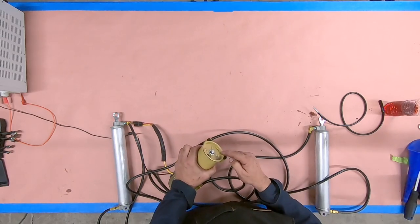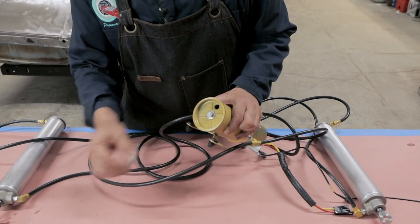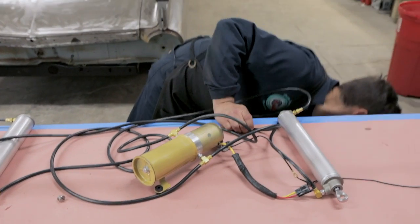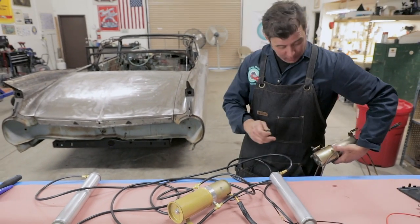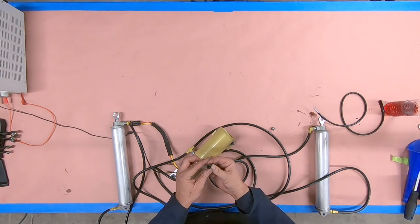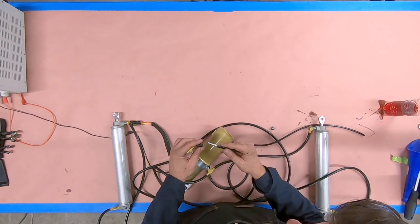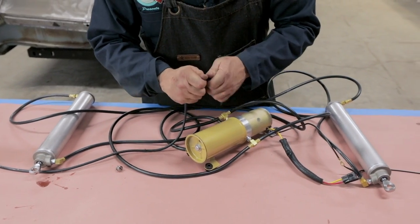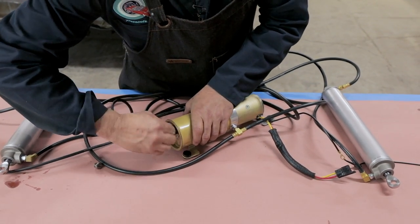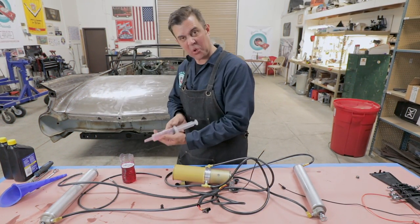If we look right here, within the pump there is a little plug. I've pulled that out, and I took from the original pump — which is right over here — a little fitting. I made a piece: took a little bit of tubing, put a hole in there, and that way I can prime the pump. It's really important — you have to get the air out of the pump and fill it up. They come dry. So let's go ahead and show how we can get that all primed. What I have is a big syringe-type cylinder.